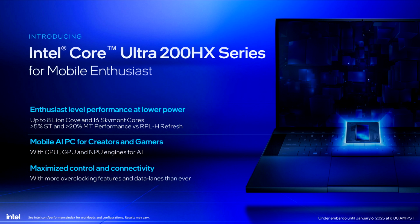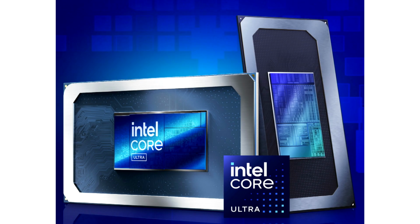Intel Core Ultra 200H and Core Ultra 200U for thin and lights. Moving onward, we have premium thin and light options in the form of the Core Ultra 200H and 200U families. The Core Ultra 200H family features up to 16 cores, 6 plus 8 plus 2, with 16 threads, 24 MB of cache, up to 5.4 GHz clocks, and TDPs that are configured between 28 to 45 watts at the base power and 60 to 115 watts at MTP. The lineup includes the Core Ultra 9 285H as the flagship, and the full specs can be found in the table at the end.